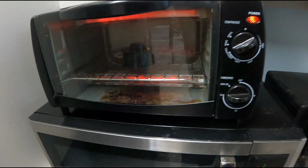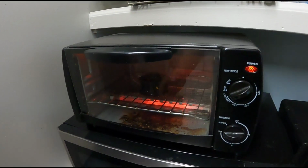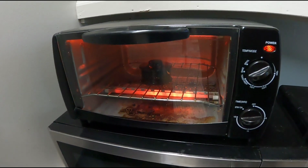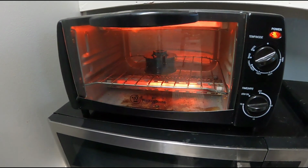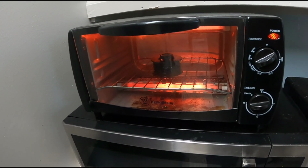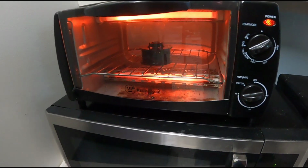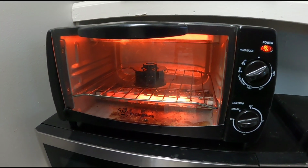You have to hurry up, run to the supercharger, or if you can get the supercharger close to the oven, that's best, and just stick it right on. Use oven mitts obviously, or if you have some welding gloves. Just let it get real hot, stick it on the front of the supercharger, and that's it. You can cool it off if you want. You can spray some water on it or something like that, but it's fine. It doesn't damage the seals or anything like that. I haven't had any problems with this. So just get it real hot, stick it on the supercharger. That's it.